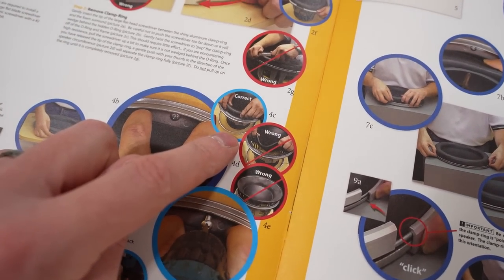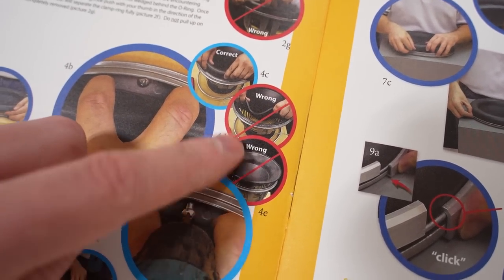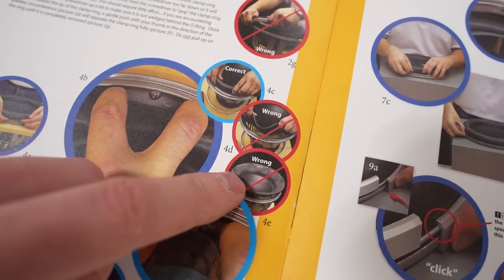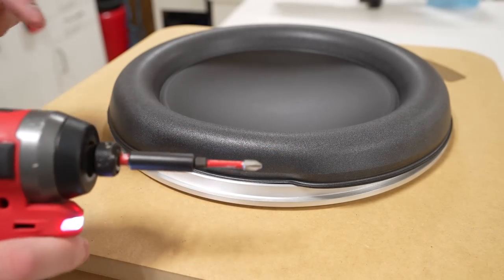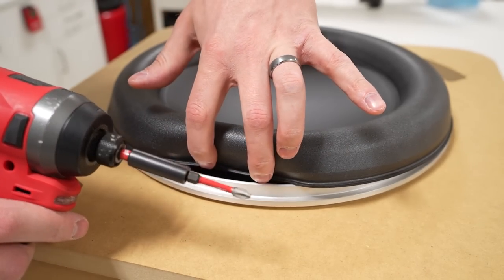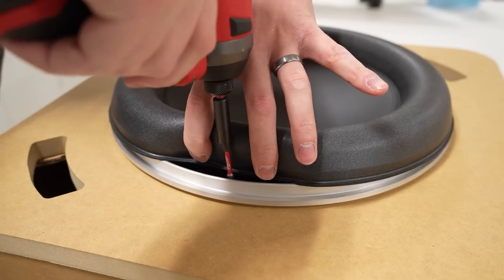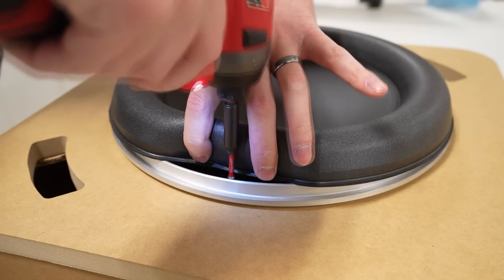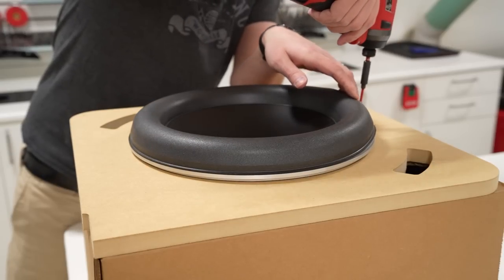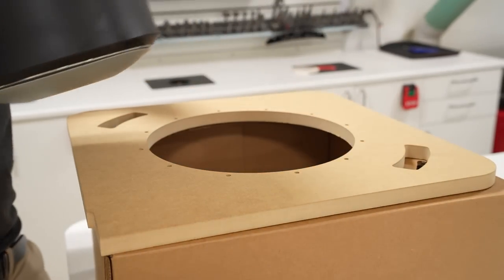On this step, make sure that you take a look at the manual in order to see pictures of the wrong way to do this. Make sure that you are not completely inverting the surround or creasing it, causing any damage. This is where we use the electric screwdriver — I find that it helps to have an extension on it. We're going to carefully use our two-finger method to fold the surround back and then back out the mounting screw. We'll repeat that process for a total of 12 different screws, and then we can completely separate the subwoofer from the baffle.